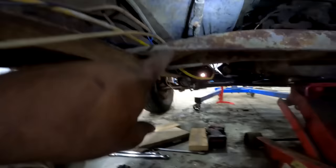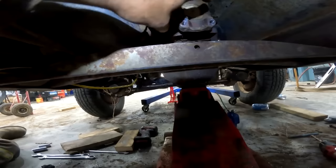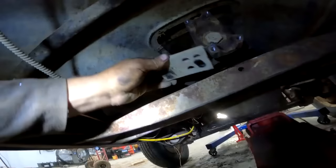So this is the cross member of the stock 79 Ford. So this hole here is off center to the passenger side, I would say 4 or 5 inches. So I put this cross member in there. I eyeballed this pinion before I put the cross member in, to the dead center of this with that laser. Remember? And it was bang on. It couldn't have been any more in the middle. So drilled some holes, bolted her in. Now we're going to use this greasy old chunk of exhaust hanger, stick her home in there, run 2 bolts in it, call her mint.